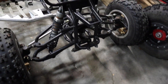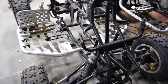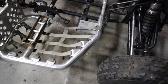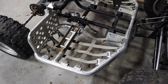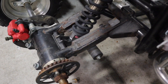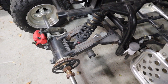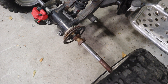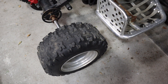As far as upgrades, besides powder coat, I'll probably get some new shocks. There's a bent tie rod that'll get replaced. I need a top plate for the steering stem and a rebuild kit for the rear master. I think the nerfs are AC but I'm trying to find out because I want new nets — if not, I could go to JSR Motor Design and have them make a set. The swing arm has definitely been welded and I have a feeling it's a little bit tweaked, so I'll probably just end up buying a new swing arm and new axle. For about the same cost as re-chroming, I can probably just buy a new one. The tires will get replaced — we'll just burn these off during testing.